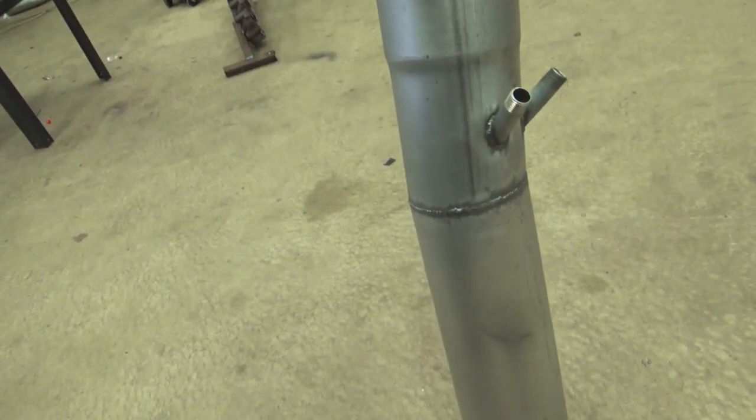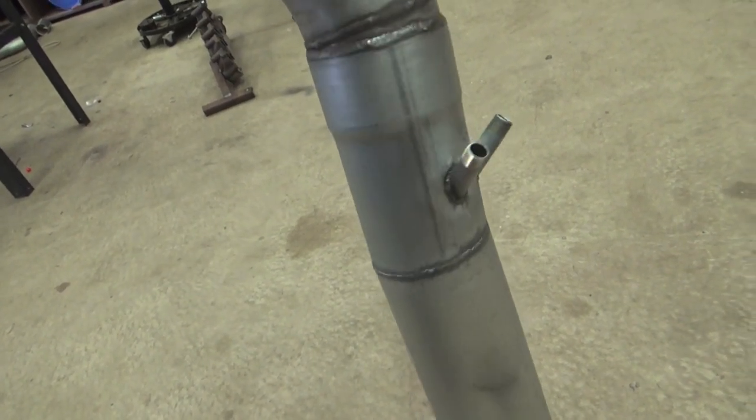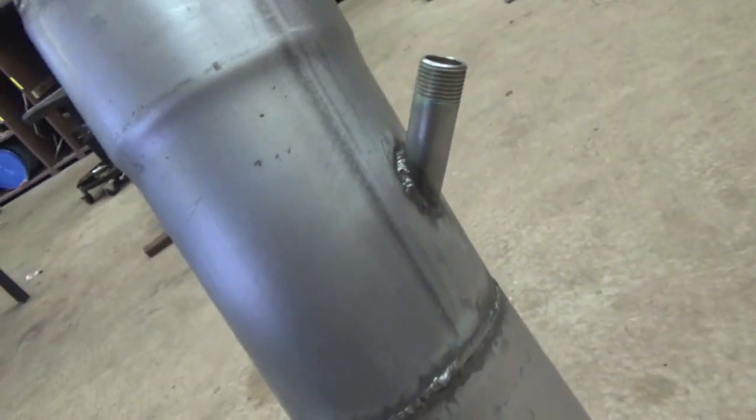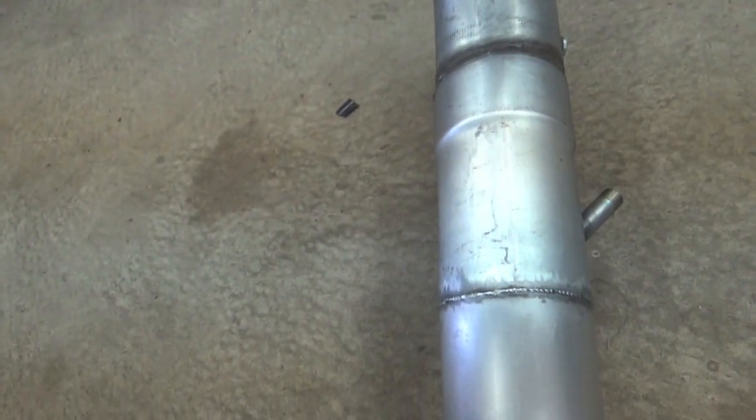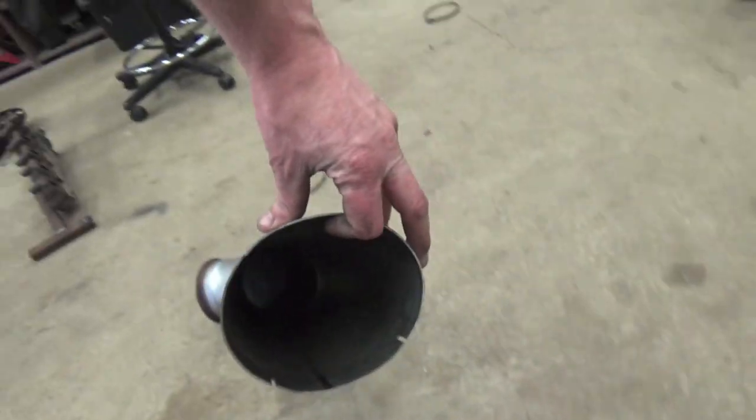We got those two fittings welded onto the down pipe for the exhaust EVAC system — you can see them right there, fully TIG welded on. This pipe we cleaned and prepped with some brake clean and sandpaper, and we've actually flattened it a little bit to try to give it a bit more wheel clearance since it goes down the wheel well. Now we're going to take apart the rest of the turbo kit, prep it, and ceramic coat it all with some VHT flame proof exhaust header paint. The problem is right now all the ceramic coat shops aren't open due to the epidemic, but we're just going to keep grinding away.